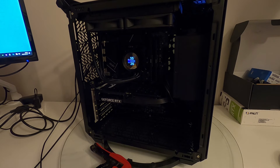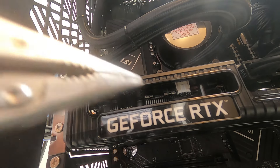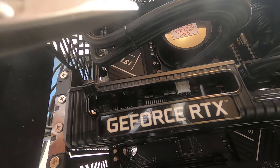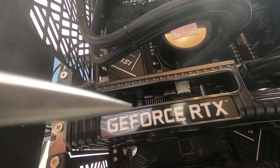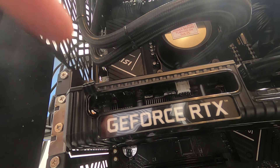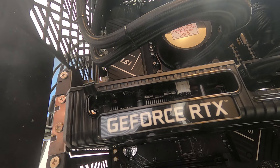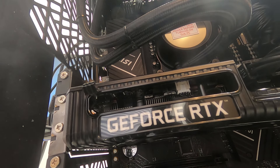I think it looks better with it off. Let me know in the comments what you think. If you try and do this and you break your graphics card, don't blame me. Use a proper tool — needlenose pliers, or in this case a Leatherman. Grip it firmly and then just gently wriggle with a downward force and it will pry out. Putting it back in is easier because the metal has memory, so it will kind of line up and you just give it a shove. If you've got any comments, stick them in the comments. Please don't break your graphics card. Liking and subscribing is appreciated — thanks for watching.